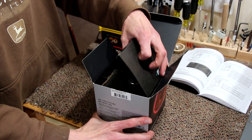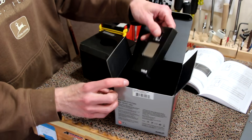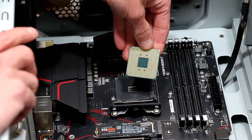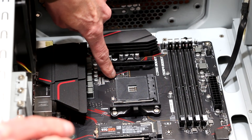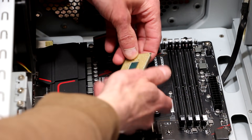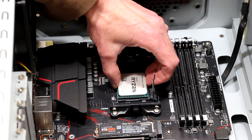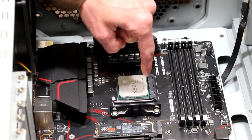Now I believe I am at the point where we can install the CPU. The AMD Ryzen 7 processor — I'm going to go ahead and get this guy installed. Then we'll install the memory and then the cooler. When you're installing the processor, there's one corner that's marked differently than the other ones. This corner has to align with the mark on the motherboard. That little gold corner goes against this right here. We're going to pull up that little lever. Carefully, carefully. Don't force it — it should just go right down in place. Then lock it down and our processor is installed.